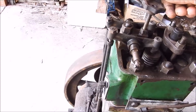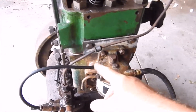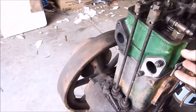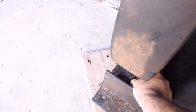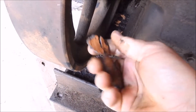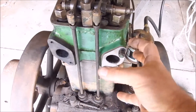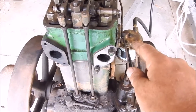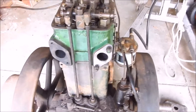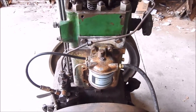All in all, very happy with it, but there are a couple of peculiar things. The water jacket and inside the head were just full of scale - more than normal, I mean completely blocked. The exhaust port was completely blocked too. The air filter that came with it was broken and had 1999 written on it, so that was the last time it was replaced - meaning it was running at least 20 years ago.